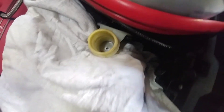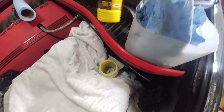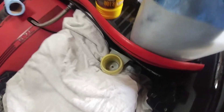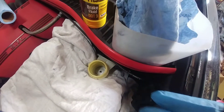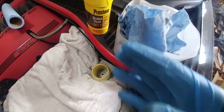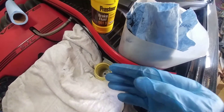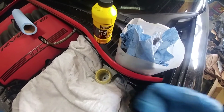What you're left with is a clean cylinder — good enough. Now I'm gonna throw in some new DOT brake fluid out of a fresh bottle I just bought, put the cap back on, go inside and cycle it a bunch so that I get the fluid mixed up. Then we'll see a fresh reservoir with some dirty fluid in it. Hopefully it'll mix new and old and get a lot of the junk to bubble up, and then I'll do the same thing — take the fluid out with paper towels, refill it, and that should be about it.